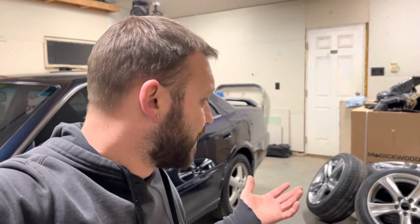So in that regard, I went with a factory Lexus IS250 wheel, going with the OEM setup. The goal was to really find something that would look as if it could have come that way from the factory. I looked at Camry, looked at Avalon, I looked at other Toyota OEM wheels, and I couldn't find something that really had the right size and width that I think would fit best. So the Lexus does offer a wider setup. This is an 18 by 8.5. And the IS250 does have a staggered setup as factory. So they have an 8-inch in the front, 8.5 in the rear.